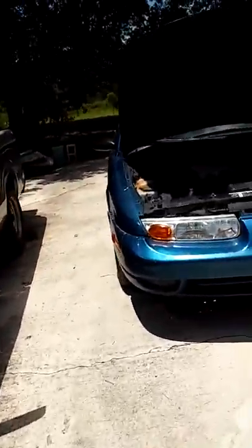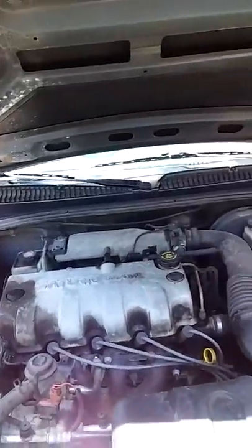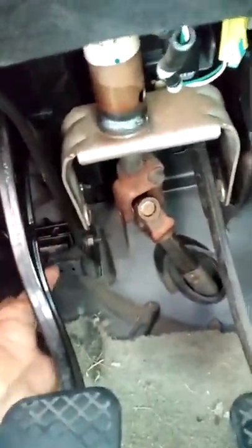She'll love it — she'll be just tickled pink. There you have it, guys. This thing wasn't cranked last night, I had to push her off and she had to get a push — it was the clutch button. I'm gonna go for a starter. This pedal keeps coming out, so apparently there's a spring missing somewhere. The button was pulled down because when that rod comes out, you can push the pedal all the way up against the thing.